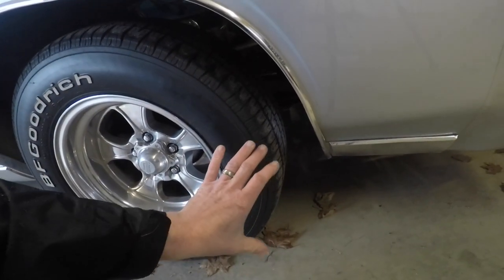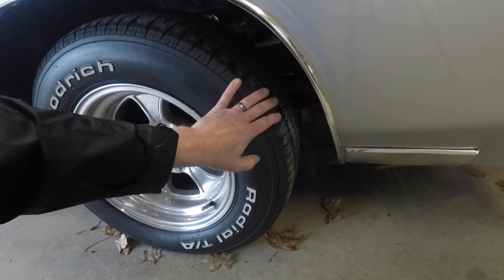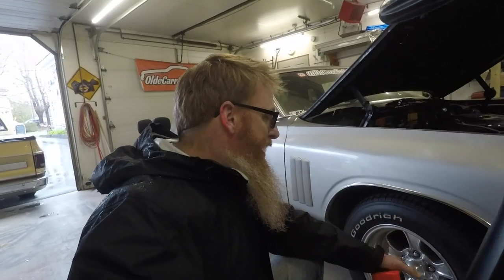We're trying to make this cribbing so that a 10-inch wide wheel and tire setup can sit on top of them and still be safe. On the old Mopar here, the front wheels are only 8 inches and with the tire bulging out it's roughly about 9 inches. I think if we cut the cribbing to about 12 inches square and take them up about a foot, that gives us lots of clearance to jack the truck up, set it down in the cribbing, and gives us probably a couple of feet to slide underneath. But before cutting all of them, I'm going to make one square and test it first — we may have to go to 14 or 16 inches. Let's do a test cut and go from there.